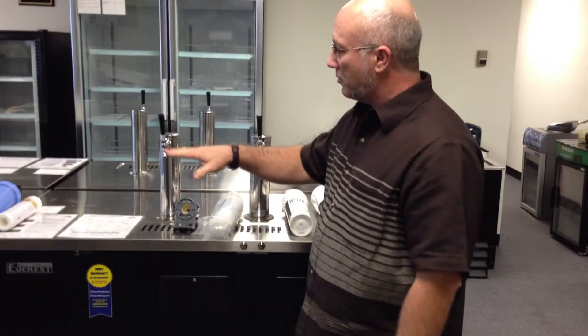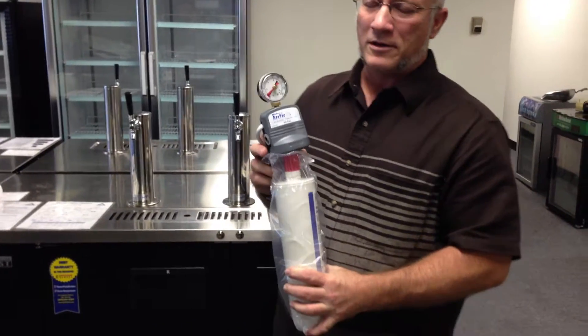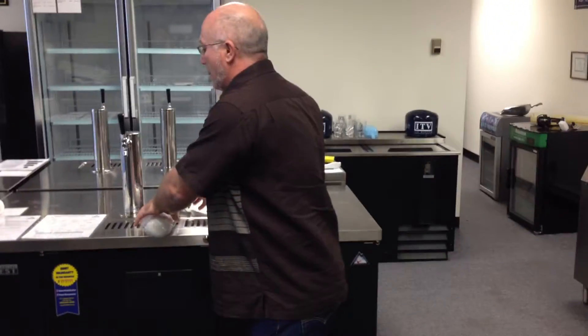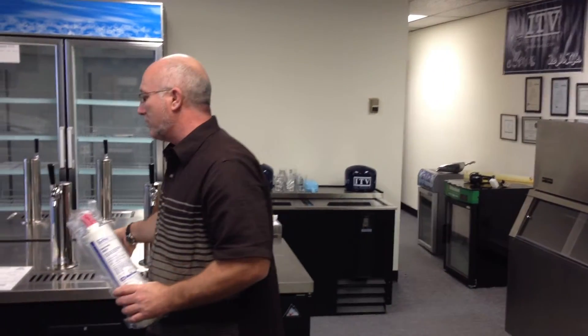The next filter is better — this is a Manitowoc AR 10,000 filter. A great thing about it is it's got a pressure gauge up top that lets you know when it goes bad. This is designed to handle 10,000 gallons. Typically an ice machine under 600 pounds will go through 10,000 gallons of water in six months. Over 600 pounds you need a larger filter — so instead of a 10-inch version, you'd get a 16-inch version, which can take you up to 1,000-pound production. If you've got over 1,000 pounds, then you're typically looking at a dual cartridge system.